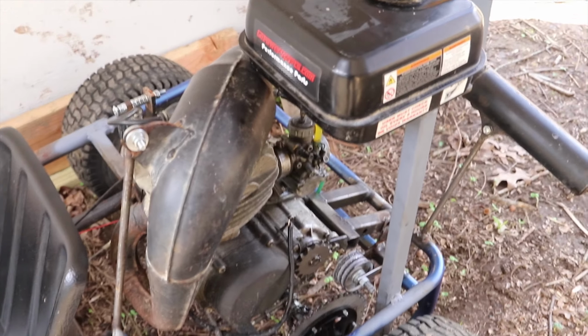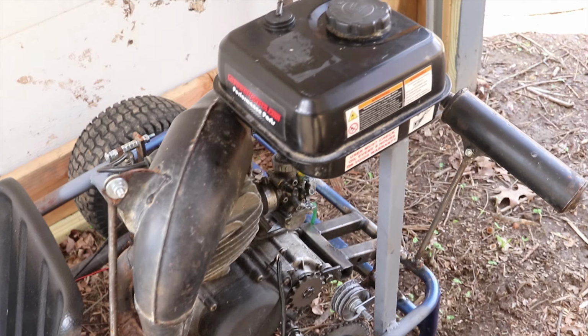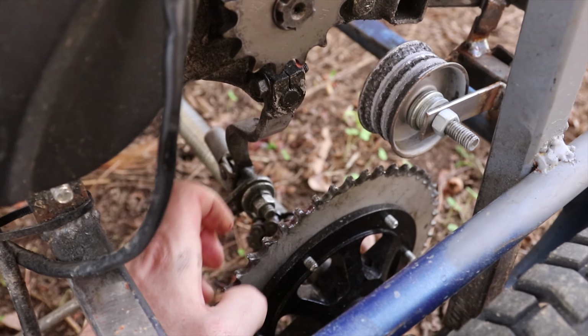It's got an aluminum split sprocket, but I am having problems throwing the chain. And I got a tensioner on here. Tensioner seems to be doing its job. Main problem seems like what I'm having now. I ordered this aluminum sprocket carrier and the split sprocket from Go Power Sports. I know everybody raves about Go Power Sports and they sponsor a lot of channels, but I did not have good luck with this sprocket. So you can see it's hard to move by hand, but this sprocket is moving.